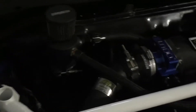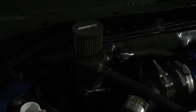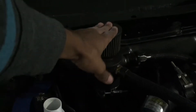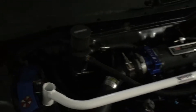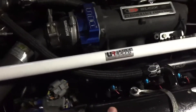This is a breather can. As you can clearly see, a breather can is not the same. Breather cans have vents or are filtered — that's on top of the can. An oil catch can setup does not. Now let's get some light here — a breather can, a breather setup, you can vent two ports in the back of the block.